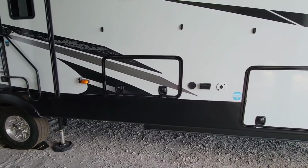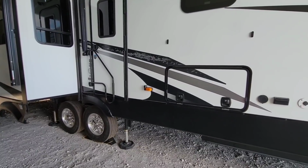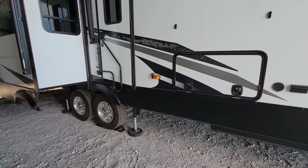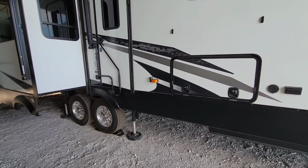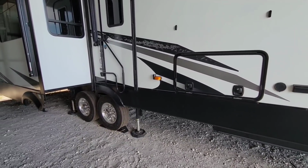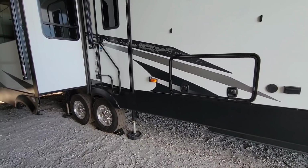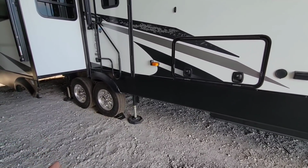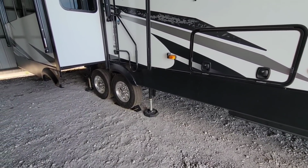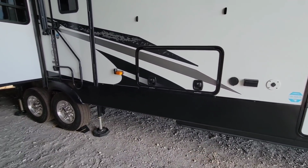But whenever you look at how much weight is actually going to be transferred to the back of the truck and how much weight I'll actually have on this RV, we'll probably at most have this thing weighed down to maybe 16,000 pounds whenever we're towing it. We're never going to be at that magical 17,500 pound. At least I can't foresee us ever being at that number. So whenever we factor our weight, we're 2,000 pounds heavier than dry. 16,000 pounds is essentially what the axle capacity of our RV is. And our tire capacity is 24,000 pounds, so we don't have to worry about that there. And basically deduct about 3,000 pounds in terms of pin weight that will transfer to the back of the truck.